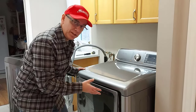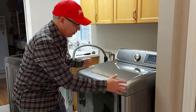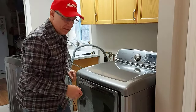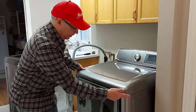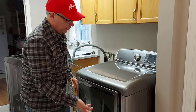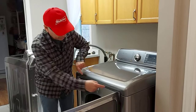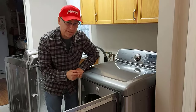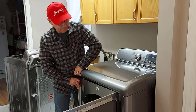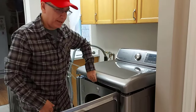If you've never done this before, I'm going to show you step by step how to take this dryer apart. You don't see any screws or handles, but right here you have lines at the front of your dryer — the top is removable and the front is removable. Open the door and there are two clips here. This is a Samsung dryer but they're basically all the same. You just lift and the front lifts up.